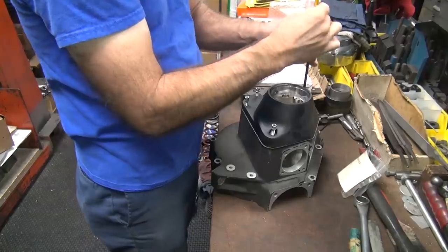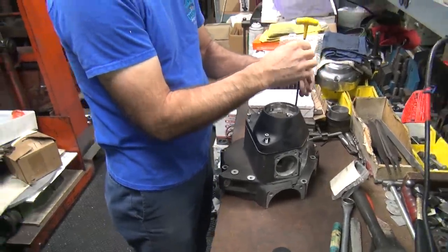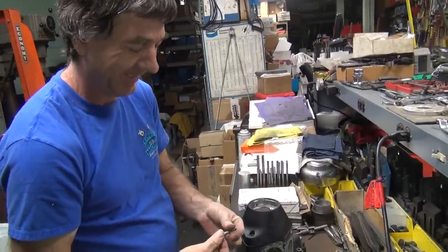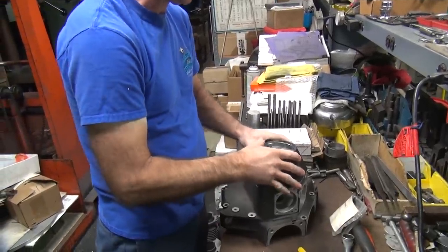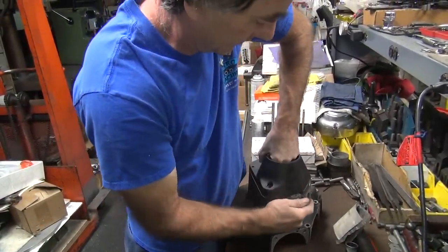By hand. Dude, I had a power tool going. I hate the hell out of it. That wouldn't make any difference, because the reamer sets the size, not how you turn it. Right. Makes it sound like it's better, but yeah, it's what you adjust it to that it cuts. Okay, let's see if I can get this thing off of here.